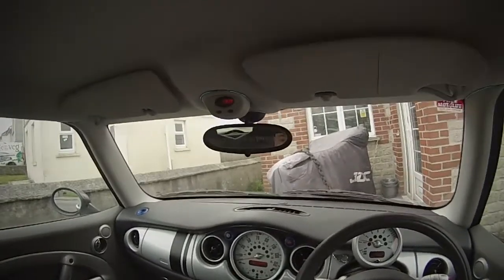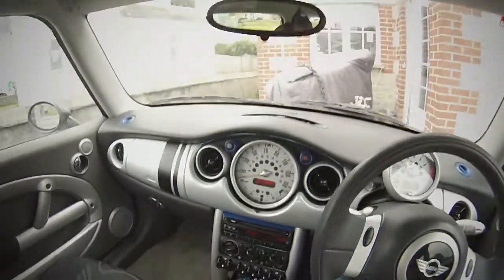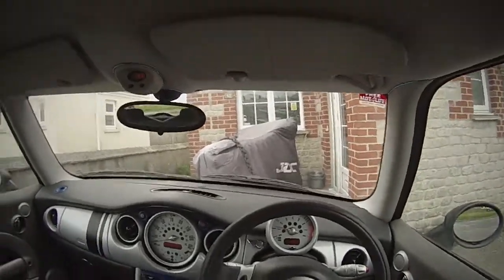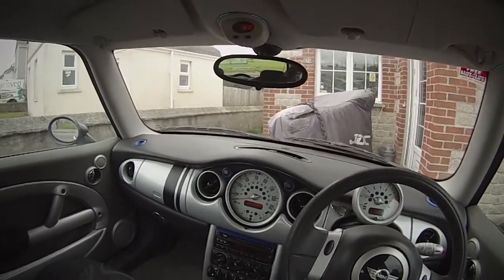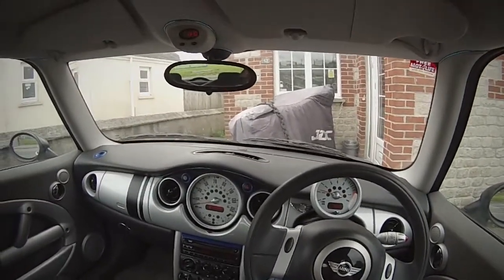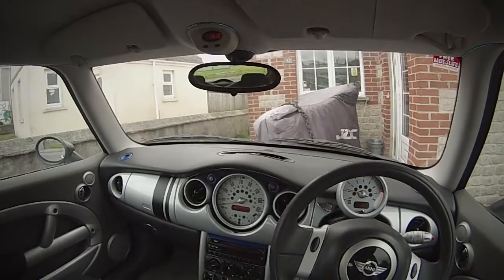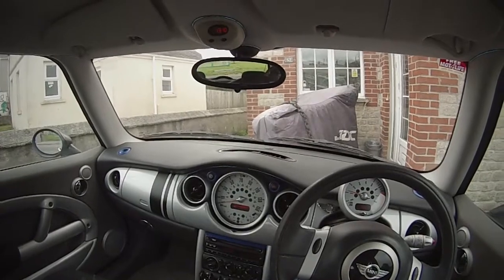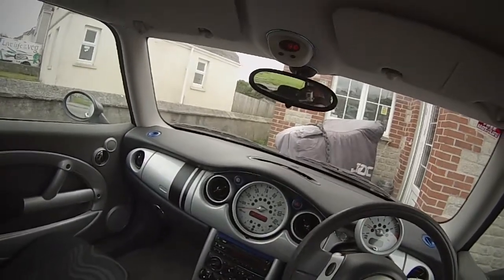So far so good. No warning lights. That's ideal. We'll let it run a bit like this. I hope you can see pretty well. So yeah, all we're looking for really is bad idle speed, no pickup on the acceleration. The mass airflow sensor has been cleaned now, so nothing should come up, which right now isn't. It's had a couple of hours on charge on the battery too. Fuel consumption possibly could be better after this